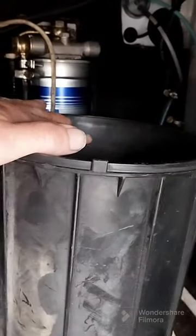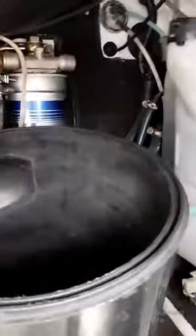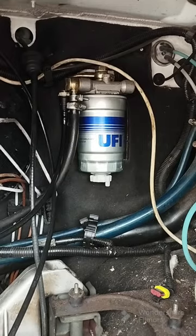And inside the air box there are 3 size 10 nuts. Use a deep reach socket and get down there, and then this should hopefully lift up out of the way. I think this one's still a little jammed. There we go. These can be a bit stubborn. Trying to do it with one hand. I'm going to have to wiggle this out with 2 hands. I'm just putting the camera off for a split second.